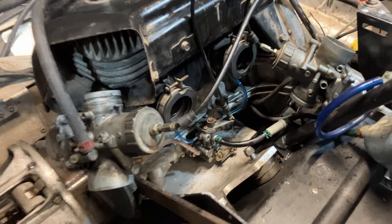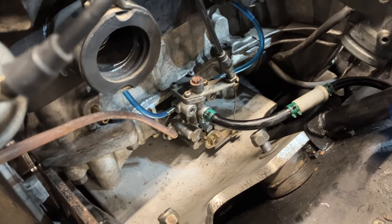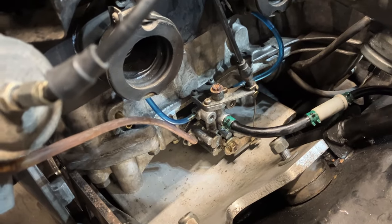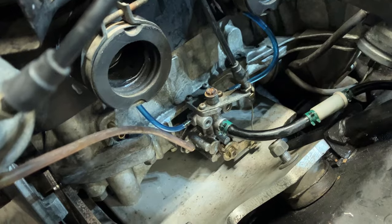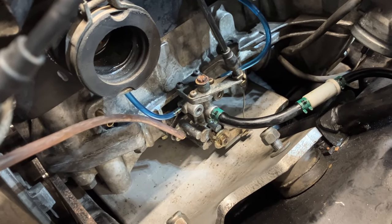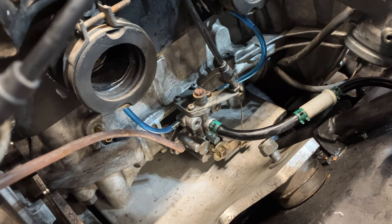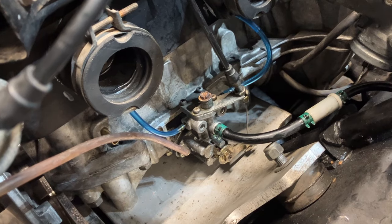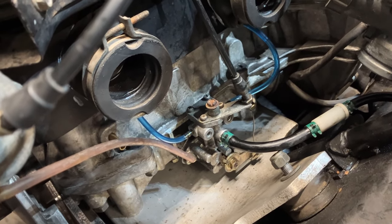So that is what you do on your oil pump, guys. Hopefully that clears anything up. If you guys were confused about how oil pumps work and the adjustment on that cable, that's what I've been taught, those marks on the pump arm. I never had one fail from doing it that way, so take it as you wish. Maybe other guys in the comments will have different ideas, but some like to set it a little bit richer, leaner, whatever. But I always was told that you want that to line up at wide open.